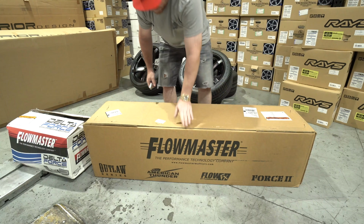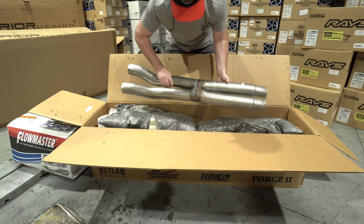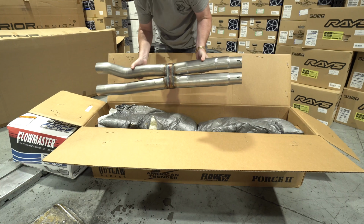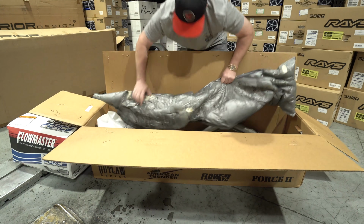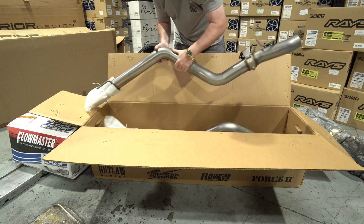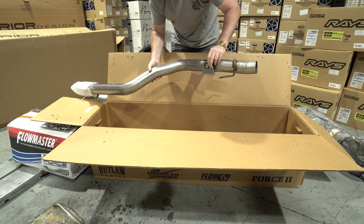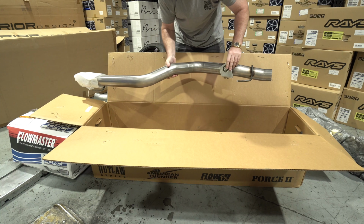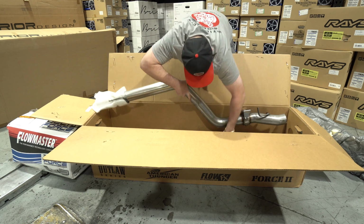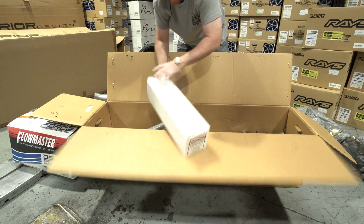All right, we got the exhaust system here, full Flowmaster catback exhaust. We've got the X pipe, nice Flowmaster logo. This is what'll give it a good sound here. Then we have more parts. Looks like we've got most of the axle back here, and the factory exhaust has valves in it, so the valves will connect here and that'll give it that sport tone, so it'll open and close. So we've got 2 of these long pipes, clamps and couplers, and let's see what we got here.